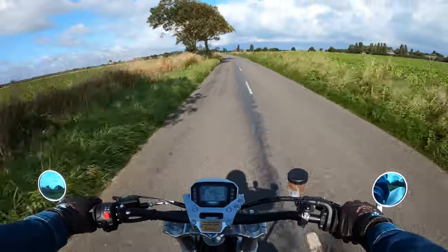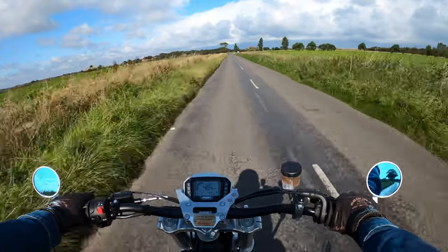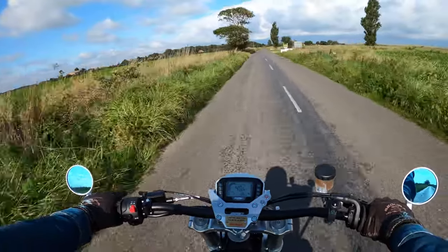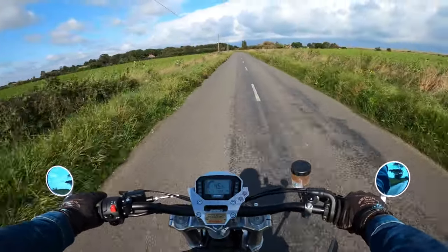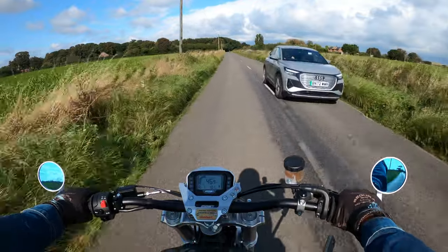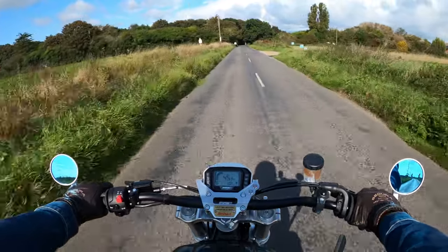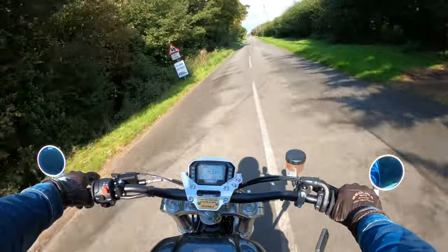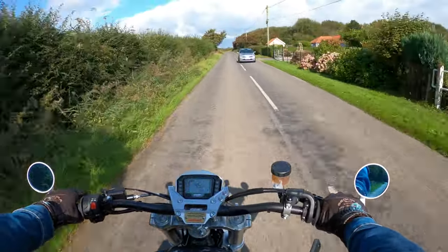Recently I have seen and read that there's been a few people out there with issues with various things on these CCMs. I think as long as they're used and not sat around for too long - leave them on an optimizer. These ones have the lithium battery, so they like to be kept on an optimizer. If the charge drops below a certain voltage on these they don't like it. So that's what I generally do - it's kind of intravenously fed by the power supply when I'm not using it.